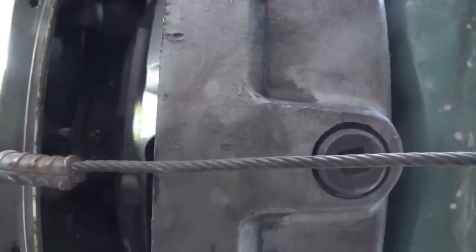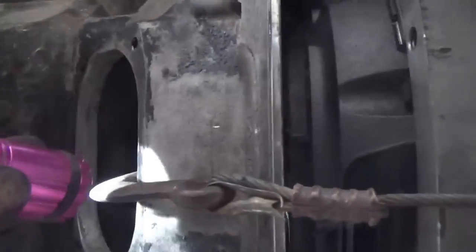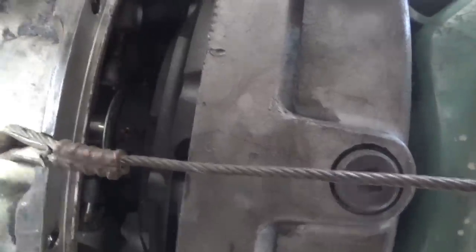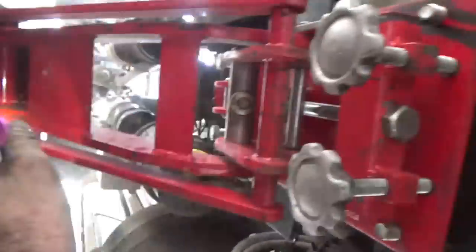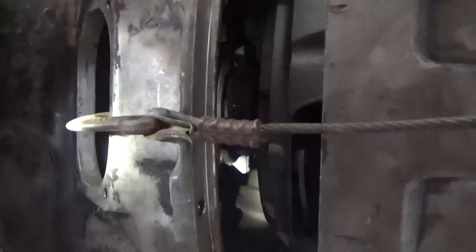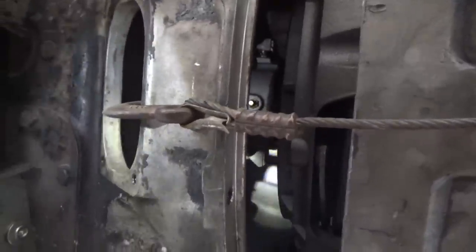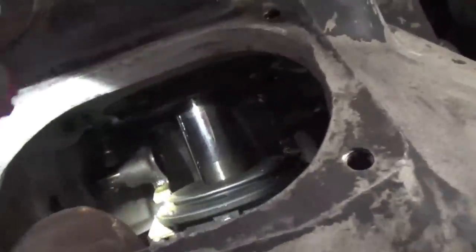I had to try to keep that measurement pretty close, and then I put a come-along through the inspection cover and over to the I-beam on the steering I-beam there. I had to put some tension on it and then raise the jack up and down a whole bunch of times until something clicked. So I started pushing the jack with my feet and got it to start moving forward.